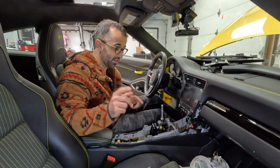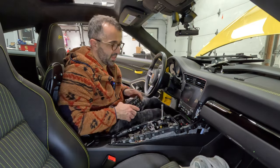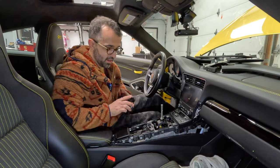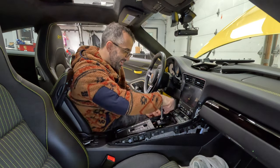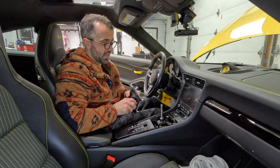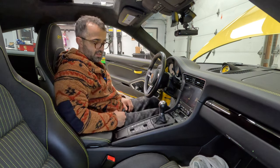Now we start putting things back together. Starting with the cable — make sure the holes are aligned and drive the screws back in. Next, take the radio out and plug the climate unit back in — there's only one way to plug them in. Then we move on to the ashtray, then this button piece, then the trim, then the side trim. Once you align all the clips, simply push them in place. And last but not least, tighten and click the final piece back in place — and we're done.